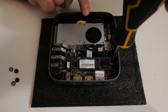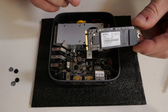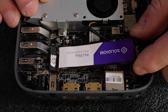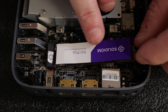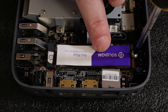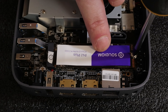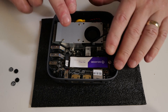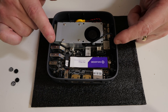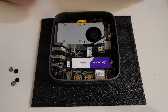Let's do the M.2 first. If you want to swap out your M.2 drive, loosen off this screw and the drive will rise to about a 45-degree angle, and you can simply wiggle the drive out. Grab your new drive — this is a one terabyte upgrade. You can use NVMe or SATA SSD-based M.2 drives on this particular chipset in conjunction with the N95 Intel processor. Put the drive in, hold it in place, and then do the screw — just until you feel some contact. Don't over-tighten it or you may damage the drive. If you need to transfer data from the old one, it's a bit tricky as this has only one PCIe M.2 slot — we have done videos on how to transfer data and will link those in the description.